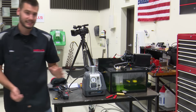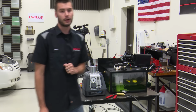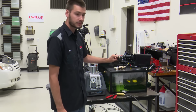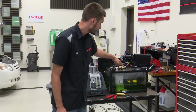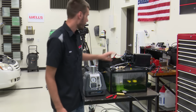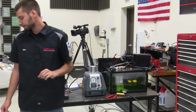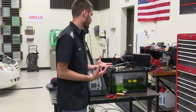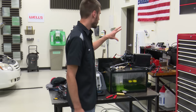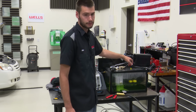So for today's testing purposes, I have put a plug into the vapor recovery port on the canister. I have a purge solenoid hooked up to this thing. It is connected to our fuel tank. We have a sealed gas cap. We have our drain here, our air drain, which is going to be one of our pressure reliefs, the drain, which is what we were just talking about. And then we have our piece here that goes to our air filter, okay?